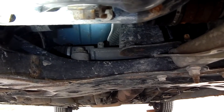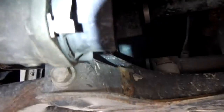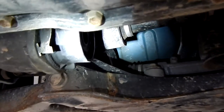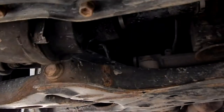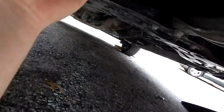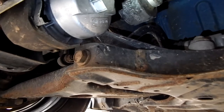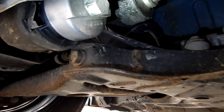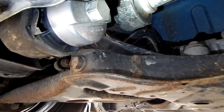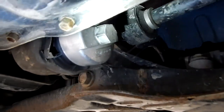Now, if you follow the oil pan, there's your oil filter cap right here for your 2009 and later Toyota Corollas. What you're going to do is take this tool and slide it right on just like so — it's going to engage it. Then you take your 3/8 drive long ratchet with the 15/16 socket, and you're going to unscrew it and let it drain. I'm not going to show that because it's pretty obvious and I don't feel like getting oil all over the camera.